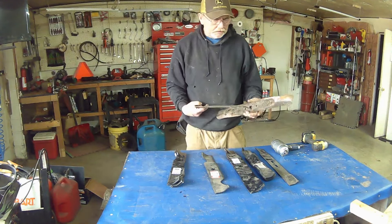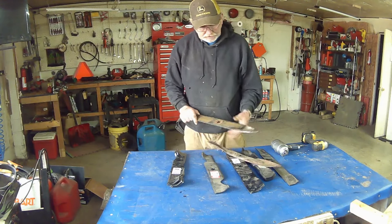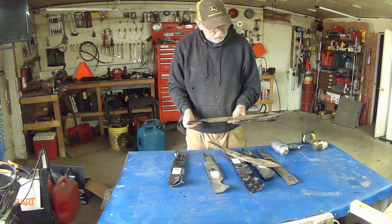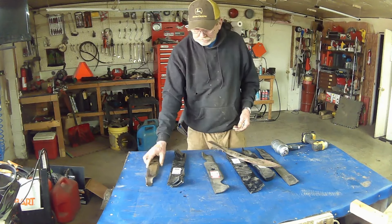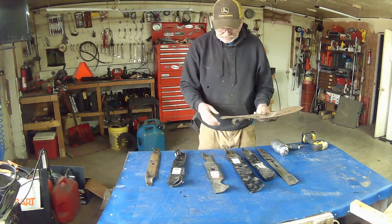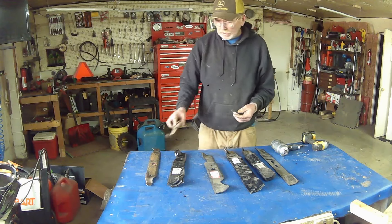And if you're taking the blade off to sharpen it, this is the time to inspect it. I've got two blades here that come off different lawnmowers. As you can see, this one ran in sandy loam where it really wore it down and it's missing pieces — that will never balance. This one here is missing pieces too, it's more complete, but it's beyond repair. It's junk.